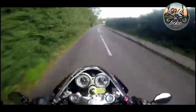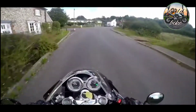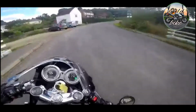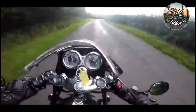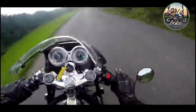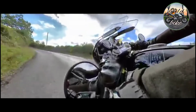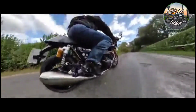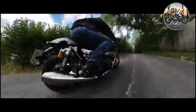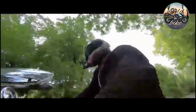Torque! The brakes are Brembo M50s now. Absolutely amazing. They've got the power. They don't have quite the initial bite of the Speed or Street Triple brakes. You need to put a little bit of pressure on them. This has got a Brembo master cylinder, but not the one which is adjustable for lever capacity like the Street Triple RS version. It's just a standard Brembo lever. It's a shame they didn't give it the same setup as the Street Triple RS, you'd get all that extra feel from the brakes.